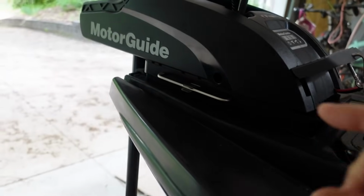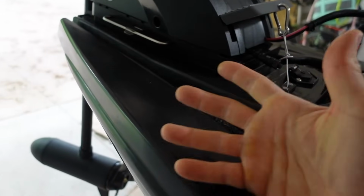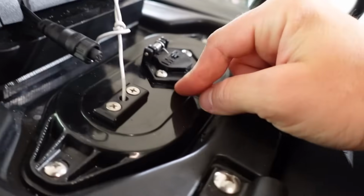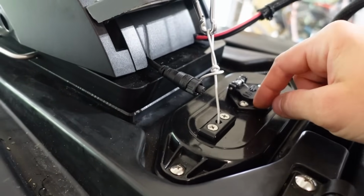Very easy to install. A little bit confusing because they had 2 extra screw holes in this bow mount plate that you don't use, which is like, okay, that was weird. Anyways, so just something to note, you only use 6 screws for that, 6 bolts rather. You've got on this front power link plate, you're gonna install your receptacle here. Easy to do. Problem is, you're really gonna wanna make sure you have a hole saw kit.